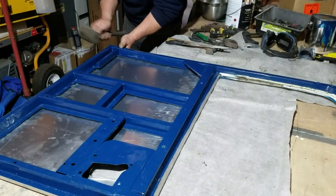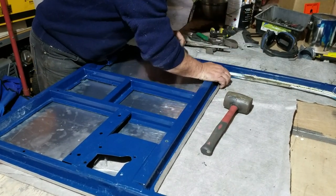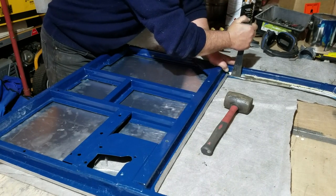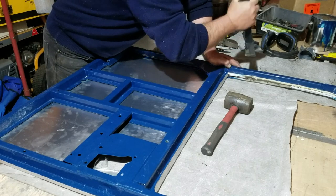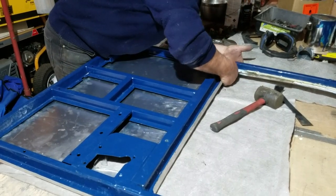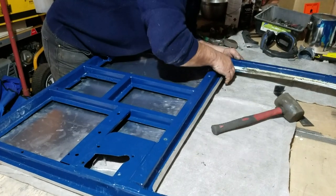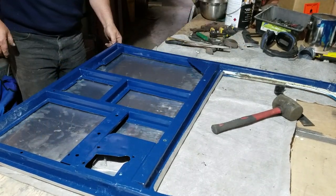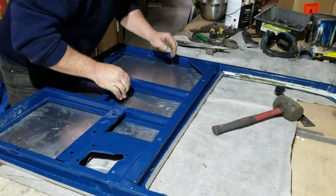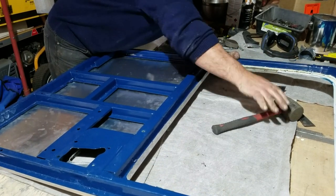You'll remember that earlier I painted the frame with the Gilsonite black tarry bitumen type paint. That's forming a barrier between the steel frame and the aluminium skin, so that hopefully there'll be none of the electrolysis that caused the problems in the first place. As I've said in other videos and earlier in this video, one of the downfalls of Landrover is electrolytic corrosion due to dissimilar metals, because those metals aren't insulated between each other. So I'm paying particular attention on just that, insulating the dissimilar metals to stop the corrosion, and hopefully this Landy will easily last another 50 years.